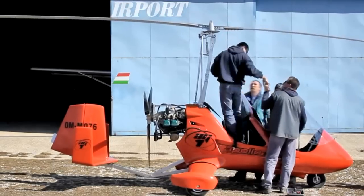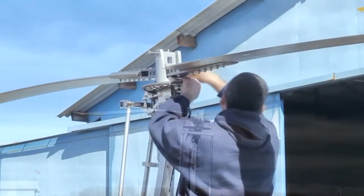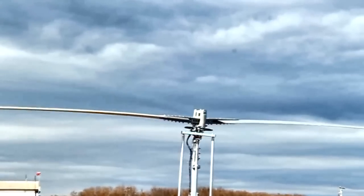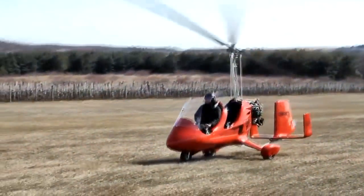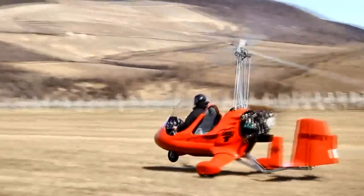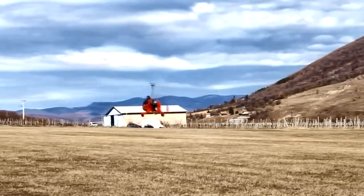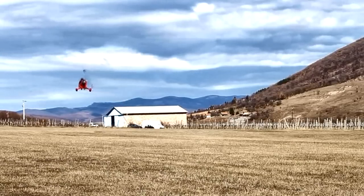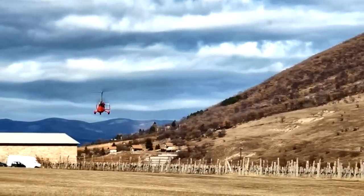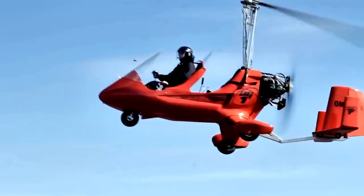Okay. And really, why is that? Well, you want to really balance the gyroplane on its main wheels and give it an angle of attack to the disc, so the pre-rotation gets you further going. The rotor RPM keeps up and you manage the energy there. You want to put some angle of attack on it, and then push it forward with the engine. And then you're in a stable environment. So basically, you're doing what we in trikes call a wheelie down the runway for takeoff. Yeah, nose off the ground a little bit, so you have the angle there, and then it lifts you off, and you're in ground effect. You don't want to get out of ground effect before you have some more airspeed. So you get to a proper airspeed and you feel the rotor has the energy, and then you start climbing.